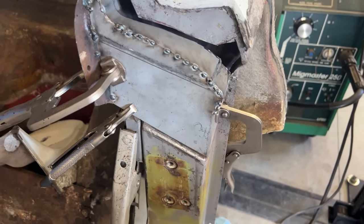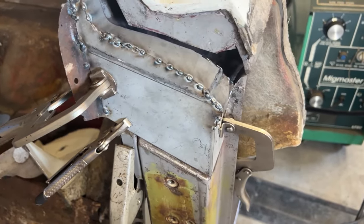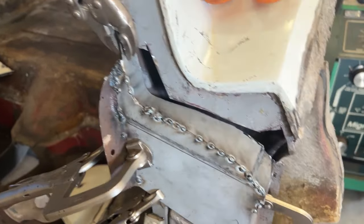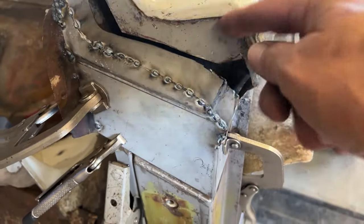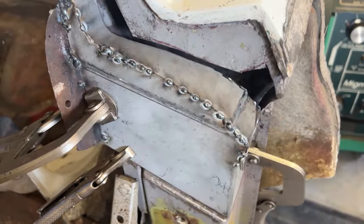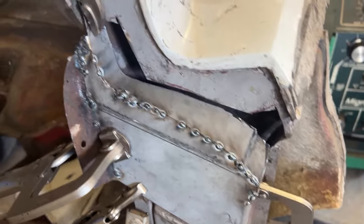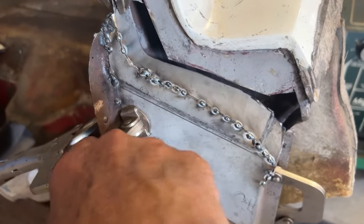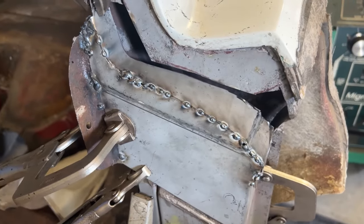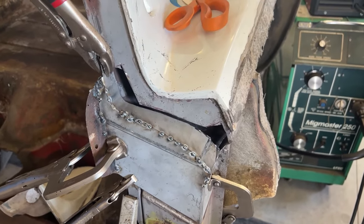You can see I have this passenger side lock pillar top cap for the coupe here tacked into place. I have to cut this plate here — this filler — tack that in, then I'll remove this and weld everything from the backside, get it nice and solid, and then weld it in. I used the original piece here because it had a nice curve and it wasn't rusted. So I'm going to go grab some lunch and come back out and finish this up.